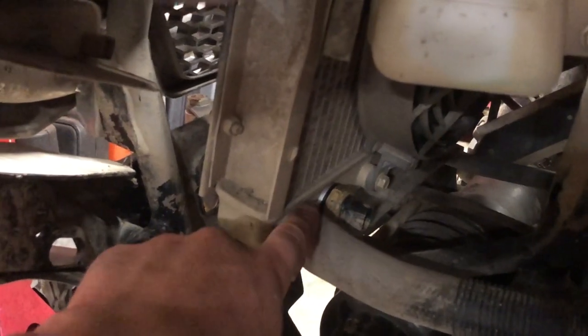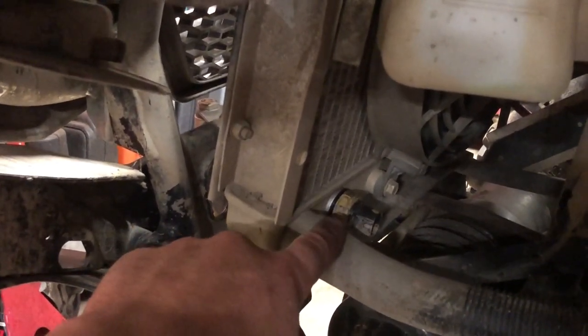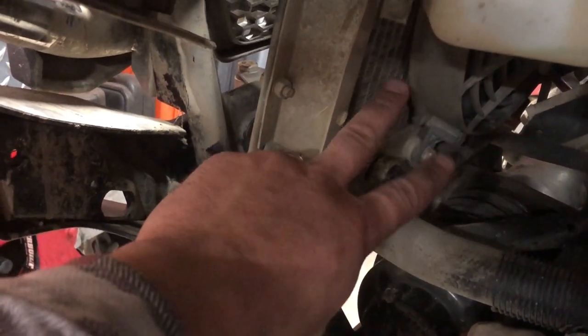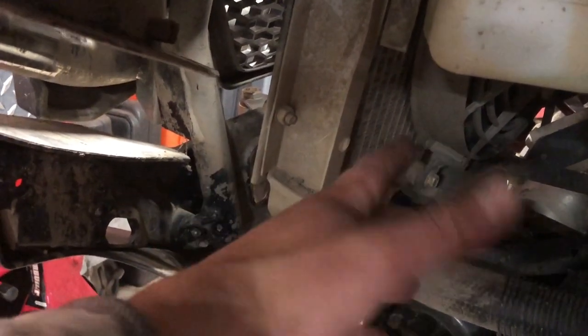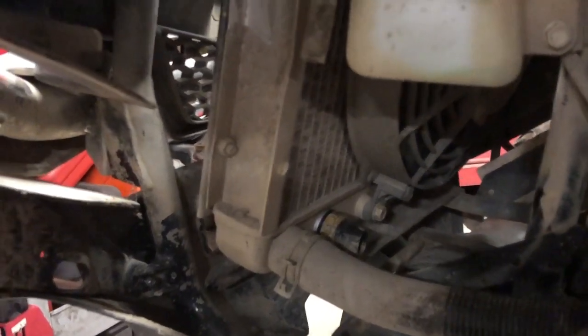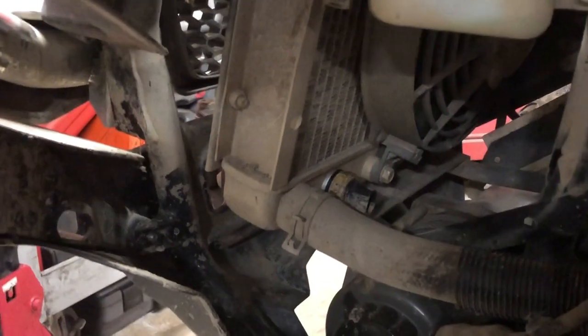We've got a new switch. We've got a waterproof fan that my dad wants me to put in. And then what I can do is take the switch out, put it in water that's like boiling, and watch the switch move. Make sure we've got continuity, or we're not gonna get continuity because the switch isn't working. It might be failing at the wrong temp, and it may collapse way up above boiling, but it's probably just bad. So we've got our diagnosis kind of completed.